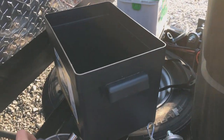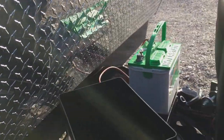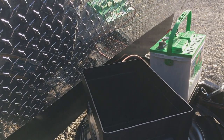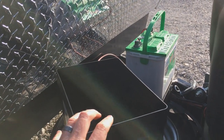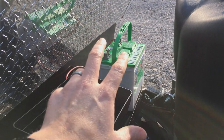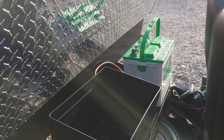See the battery there and the battery box here. For those of you who don't know or are just now looking into this, there's quite a bit of electronics in newer campers and RVs these days, and a lot of it runs off of 12-volt. What you can run into when you're home is you're always having to disconnect your battery, otherwise it's going to drain. Phantom, vampire drains will drain that battery down.